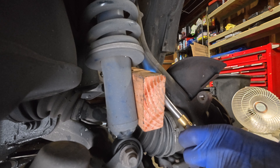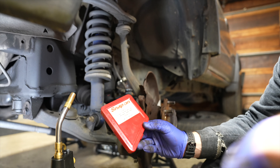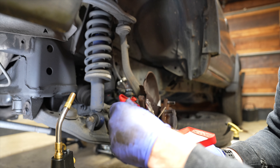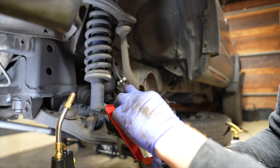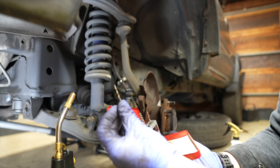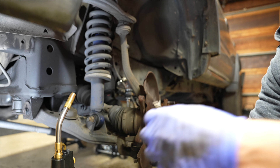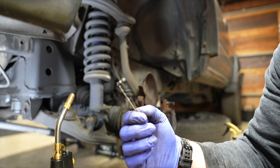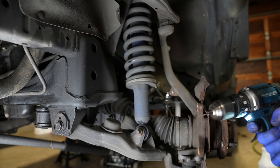It's time to turn to the last resort: we have to drill through that entire bolt. This is a screw extractor set from Snap-on. The main thing is it has a left-handed drill bit. We want to start with the tiniest drill bit in the set to drill a pilot hole through the bolt, making sure it's perfectly straight. Make sure you add a center punch and it's set nice and straight.